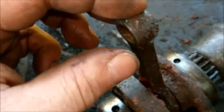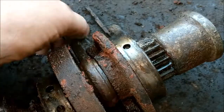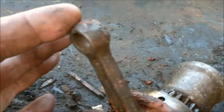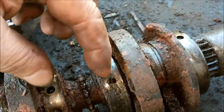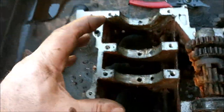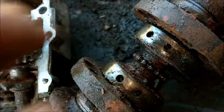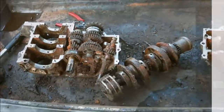Anyway, this is the conrod. This is the small end, and that is the big end for those of you not in the know. And it's called small end and big end for obvious reasons, really, isn't it? Yeah, it's a four bearing crank. You've got the outside bearing, the centre two, and then the other bearing there. And you can tell you've got the four posts that the crankshaft sits down into. And this gear drive here drives the cam chain to do the camshaft. Right, learning all the way. Okay. Yeah, drop us a line, guys. Cheers.